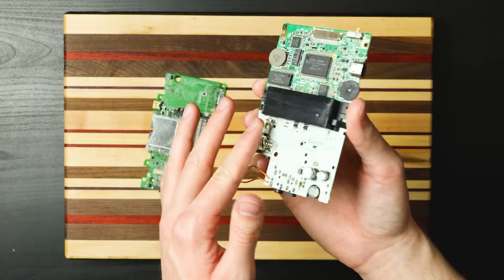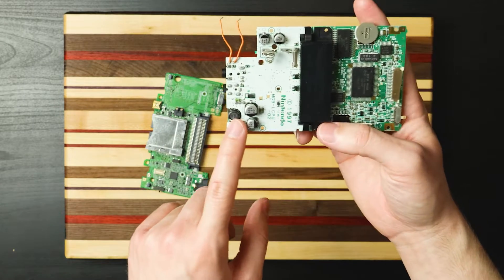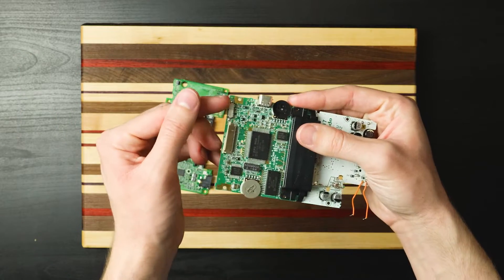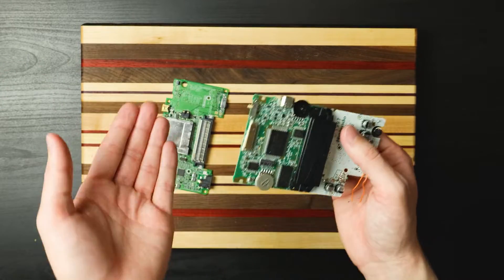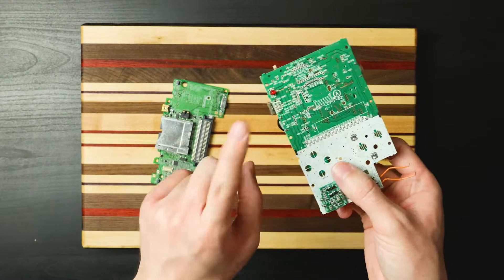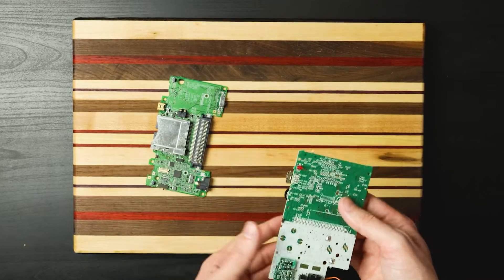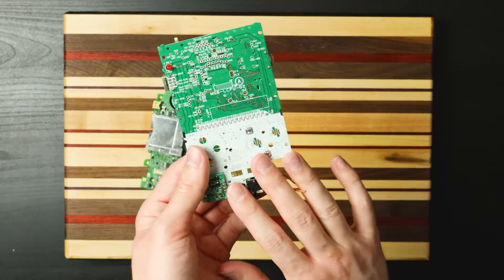I reflowed the solder on the headphone jack, the power jack, the power board, the capacitors, any solder points that really looked dull, and both the contrast and volume wheels, as well as cleaning up the power switch — that's a go-to move of mine that I think everybody should do. So it's probably time you clean your power switch, even if your Game Boy is working fine, assuming you've never done that before. And it's always good to reflow the solder on the link port too. For Game Boy Advances, I'd be reflowing the L and R buttons, and for the SP, the charge port, battery connector, pretty much anything vital.